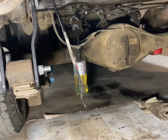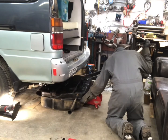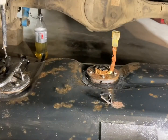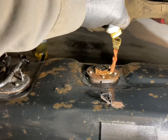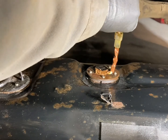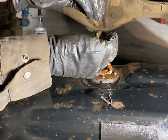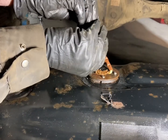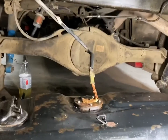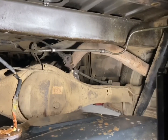There's my temporary fuel tank. Using the same floor jack, I just slide it in — I'm going solo tonight. I'll spray the connector to clean it and put a little bit of grease in there to protect it from moisture. Apparently you can access and change that sending unit from up inside the van if you're so inclined — good to know. With that connected, I carefully push it into place and jack it up.